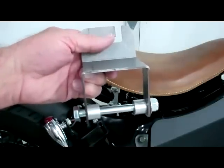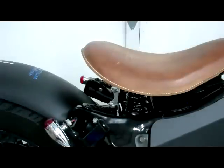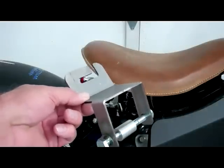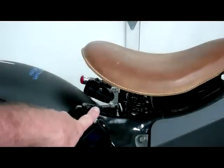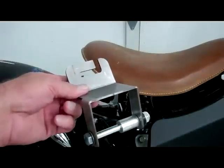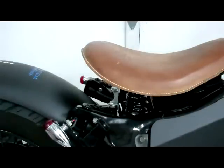These bushings go like this and the shock mount is in between these two bushings right there, so pay attention to that. The other thing to mention is that you want to do these cuts before you put this bracket on, so you can get down in there. But you want to put this bracket on before you continue putting this piece on, because once this piece is on it's going to be hard to get this in. Make your cuts, then put this bracket on — that's a good sequence to follow. We've numbered the items on your video menu to give you an idea of the sequence of events. You don't have to stick to it, but following those numbered guidelines should make it a little easier to install the kits.